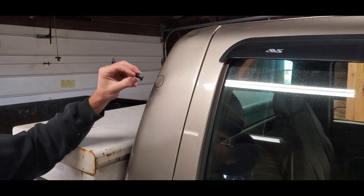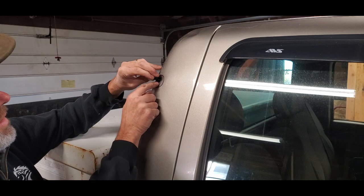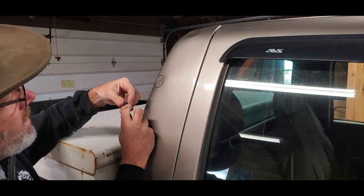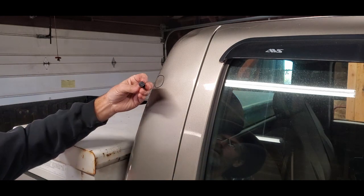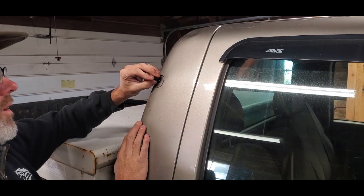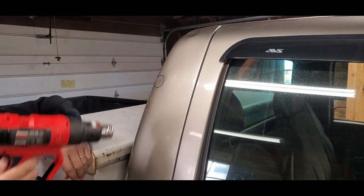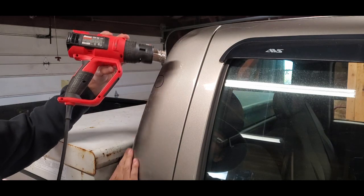What I'm going to do is take this tab. I've got a tab that's a circle because this is roughly a circle-sized dent, slightly smaller than where the damage is. If this was a big tab and I put it clear out here, it would be glued to areas where there is no dent and I'm not going to get this pulled out like I need to. So I've selected this small round tab. I'm going to glue it into place and use my puller. Now I've already wiped this down and cleaned it, and I warmed the metal up a little bit — it's about 50 degrees out here. I don't want to put hot glue on cold metal because it's probably not going to stick very well.